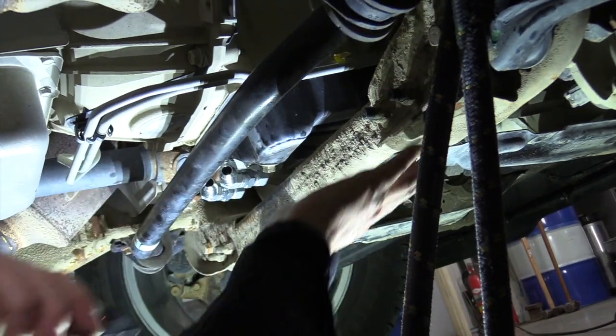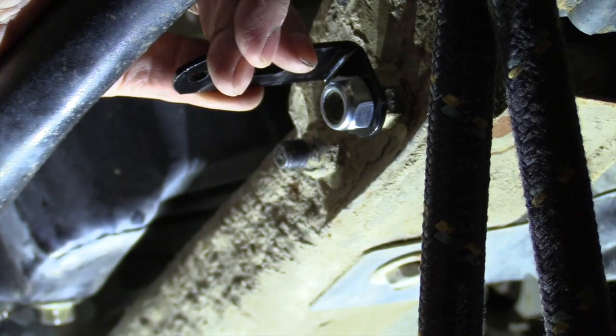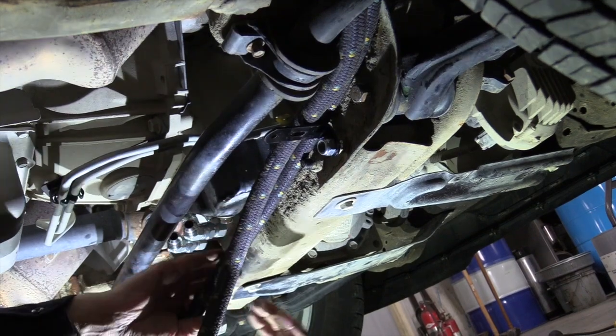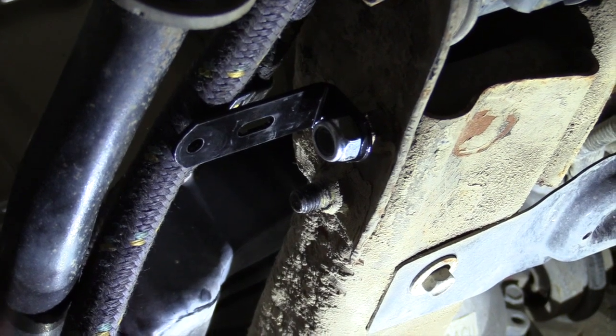Right here on this cross member underneath the engine, there are two bolts sticking out with quite a bit of threads on them. We're going to use the one that's closest to the wheel. We're going to put a nut on — supplied with the nut — and this bracket I supply in my kit. We're going to take that and use the threads on it and snug that baby up. Those hoses are going to be on the top side of that. The oil going out is the first one I'm hooking up, and I've got a clamp on there ready for it. That clamp's going to go right on top of that line support bracket.